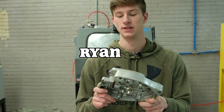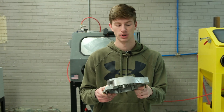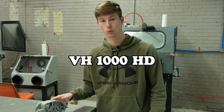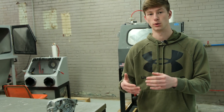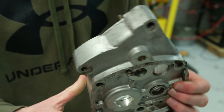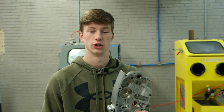I've got another piece off this 1972 Triumph that we're restoring. I don't exactly know what this piece is — it all came in a box from a customer — so we're just going to polish this stuff up and make it look great. Today we're using our VH1000HD with glass bead, because glass bead is the perfect choice for aluminum parts. As it flows across the surface it rolls the aluminum and gives it that nice polished look, and also prevents further corrosion. You can kind of see, if you look close on this part, where it's just picked up dirt over its time in service. Without further ado, we're going to clean this thing up and show you exactly how we do it.